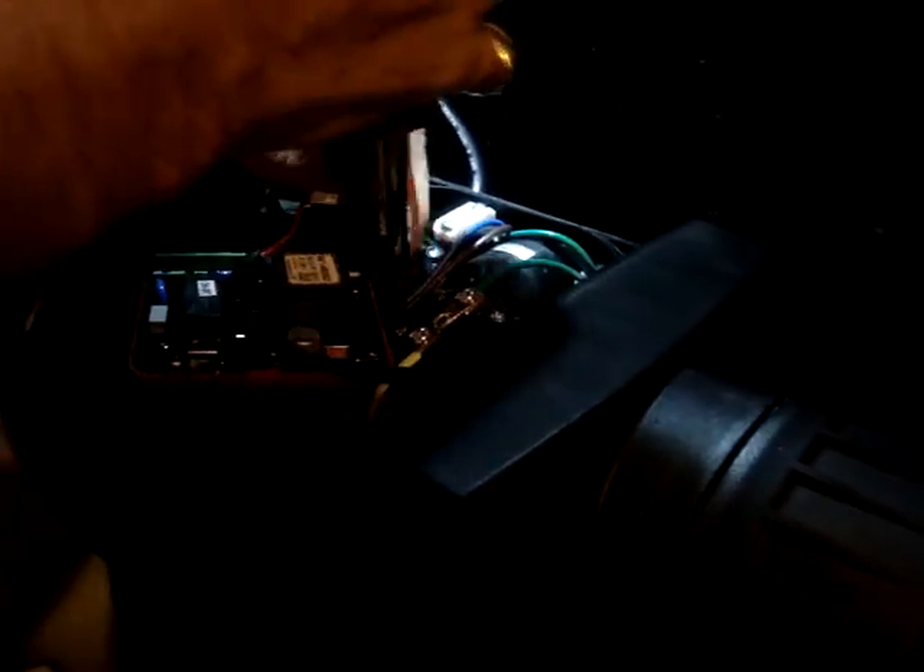Just for reference, we shut off the water supply coming into the pump, we left open the supply going to the house until the pressure went down to zero, and then we bypassed it all and unplugged it.